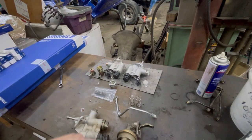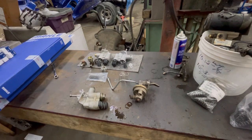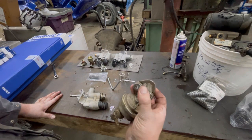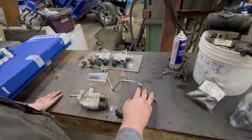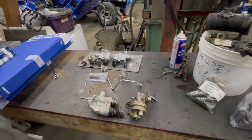The diaphragm pump is an inferior design as far as I'm concerned. The VE lift pump is a diaphragm style, and I hate it because usually the primer doesn't work — though this one actually does. These are bad for failing and they don't keep up. If you're running black diesel or alternative fuels, I recommend upgrading this before anything else, because the VE relies very heavily on fuel going to the pump to stay lubricated and cooled.